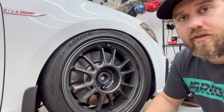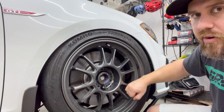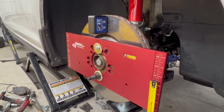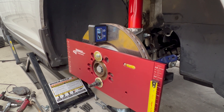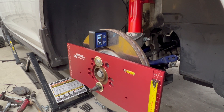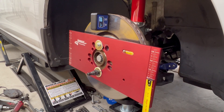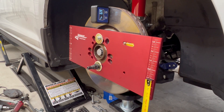As mentioned in the previous ride height video, I took measurements of my fender to the center of the hub at stock ride height as a baseline, then removed the entire strut assembly, removed the spring, and reassembled everything minus the spring back onto the car. This allowed me to jack that corner of the car through its full range of motion without the spring in the way. With an angle finder stuck to the brake rotor — torqued down to keep it flat against the hub — the angle gauge was zeroed at 364 millimeters center of hub to fender as my stock ride height reference, then raised and lowered through full bump and full droop, noting the angle finder readings every quarter inch.